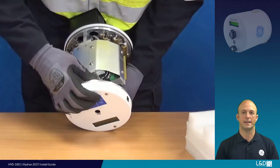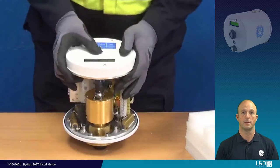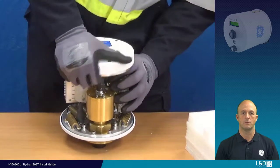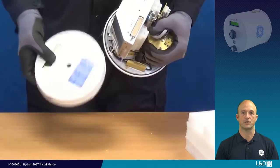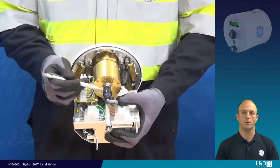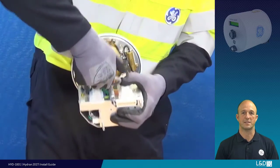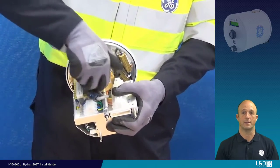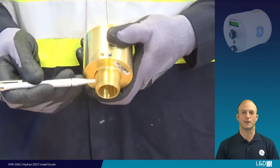To remove the sensor, first remove the CPU. Remove the two screws as indicated by the arrows. Now with a little effort ease the CPU off the two extended posts and central locating pin. If the CPU loosens at an angle, return it to its fitted location and retry, maintaining a level position to achieve removal. After removing the CPU, now unscrew the electrical connection from the sensor — twist anti-clockwise to remove. Now it should be possible to remove the sensor by hand as shown.